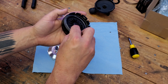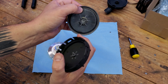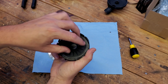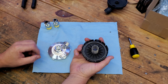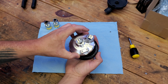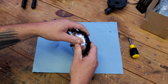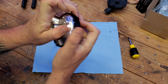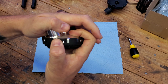You don't need anything from the bottom piece — that's done. When you set the cap in here, you can see it's got a channel in the rubber diaphragm, and if you look inside the cap, there's a channel there too. You want to make sure that sits all the way down in there. Then take your spring — it doesn't matter which way you put it in — and just set it here. The easiest way to do this is not to flip it over because everything will fall out. Take the housing adapter, line up with the tabs, set it in here, and then press it shut. It might take a little bit of force because this is a very tight fit and it's designed to be that way. Make sure everything's lined up with the tabs correctly, then use your thumbs to press them all the way down shut.